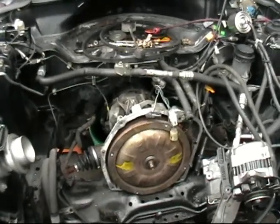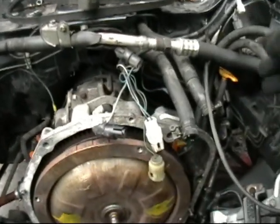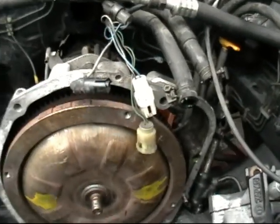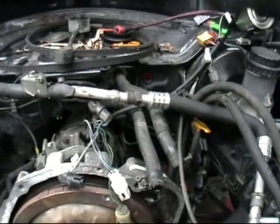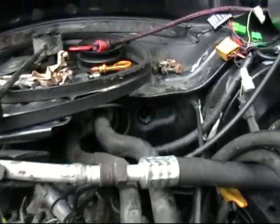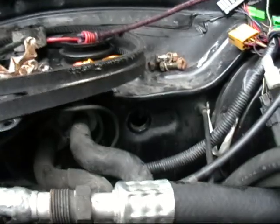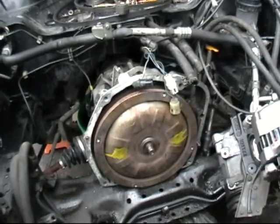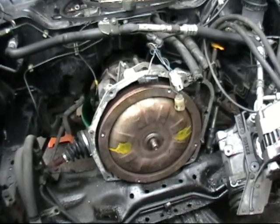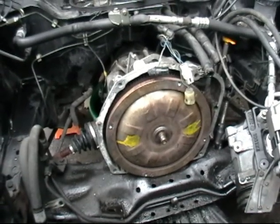As we can see up top, we have our transmission ready to come out. The axles have been pulled off the axle stubs. The speedometer cable has been pulled out from the firewall, and the reason being is because we need to swap the cable over with our 5-speed since the automatic's cable will be too short. To go back together with the speedometer cable, we will have to pull the instrument cluster back in order to plug it in. In order to avoid a mess and have less bulk weight to wrangle, it's a good idea to pull the torque converter off the transmission to save some weight. If you pull it out and tip it down right away, you can avoid much spillage.